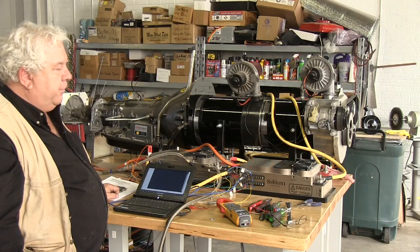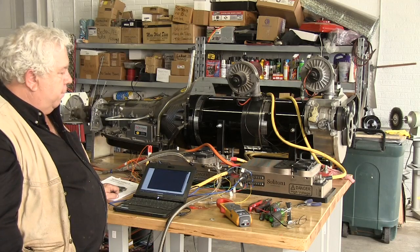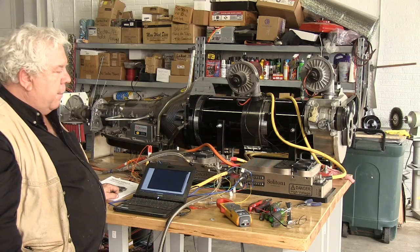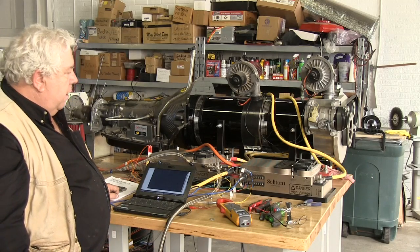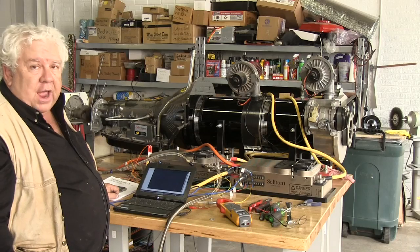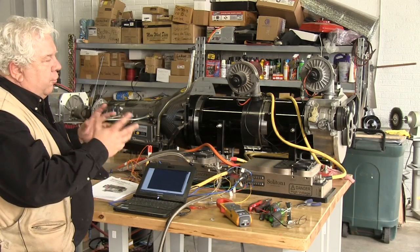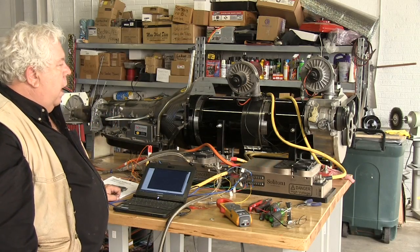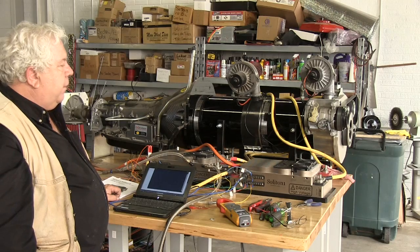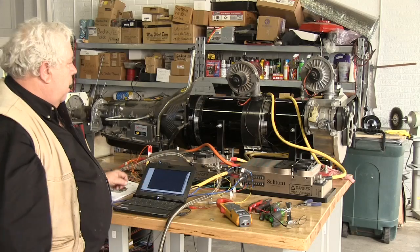These PIDs, although they're set up identical, are kind of a random process. They're going to come up with different values instantaneously, and they're both driving the same shaft ultimately. There's not really two motors fighting themselves. That's not really what's going on. But we can have uneven loads as far as which one's providing what percentage of muscle.